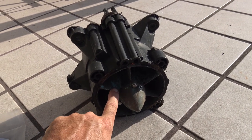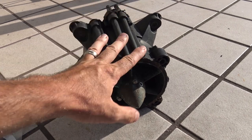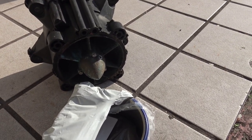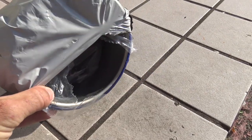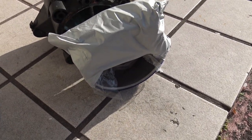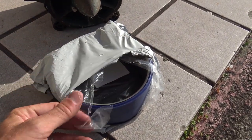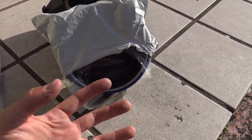One of these vanes inside my plastic pump is bent, and that does cause the flow not to come out like it should. So I'm going to use this bronze vane pump as a candidate and rebuild this one. I ordered a new wear ring — the one I have on the ski now was a knockoff OEM, a Delrin plastic one. This is a WSM stainless steel wear ring with a stainless steel inner. The wear ring is designed to be the break point in your pump. Say you suck up a rock — instead of trashing your $300 racing impeller, you trash the $30 Delrin plastic wear ring. It's very crucial that the clearance between the impeller and the wear ring is completely tight, as that's what creates your jet thrust.